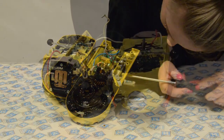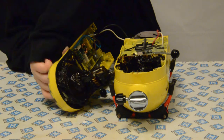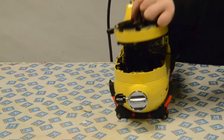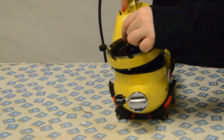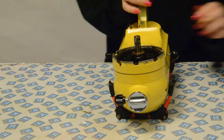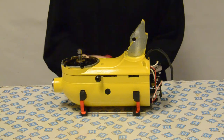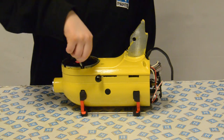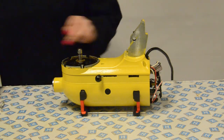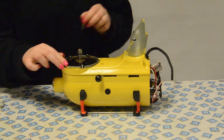Now you need to put the gear case back onto the housing. This should just place on or fall into it. But if it doesn't, just jiggle the shaft until it's found where it's meant to sit properly. Then you can just remove the extra grease around the edges. Please be careful that no wires get trapped. Now you need to insert the 5 special screws and the 4 mounting screws, tightening them with a screwdriver.